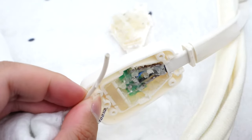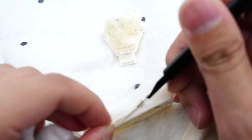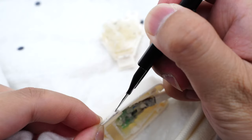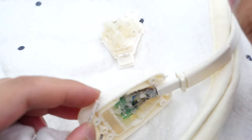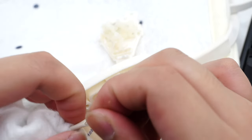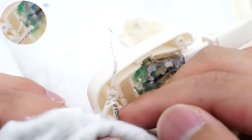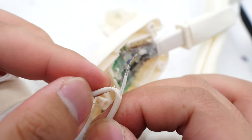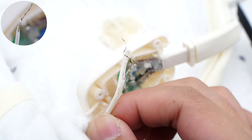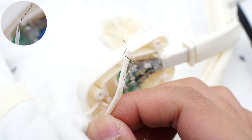Using a knife to remove the outer layer for a closer look, the internal copper wire is wound on a heat-sensitive material for overheating protection, and the internal heating wire is wound on fiber material. When the temperature is too high, the heat-sensitive material melts and the heating wire short-circuits with the copper wire, then the fuse inside the controller is blown for protection.